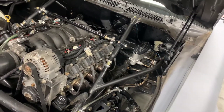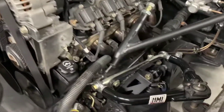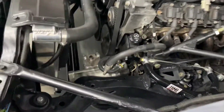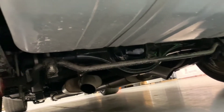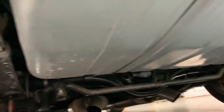I haven't got to drive it as much as I'd like, so probably just getting some seat time on it. The other thing is I welded the whole chassis, because from the factory it was just not that great. We welded the whole chassis, put in solid bushings. Oh, and I have subframe connectors under it. In the rear end we have the Ford nine-inch.